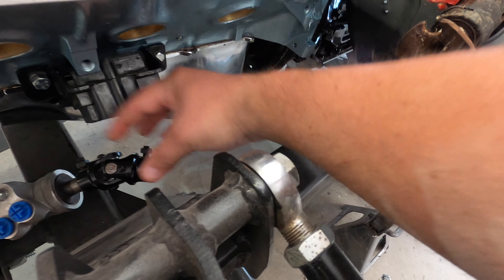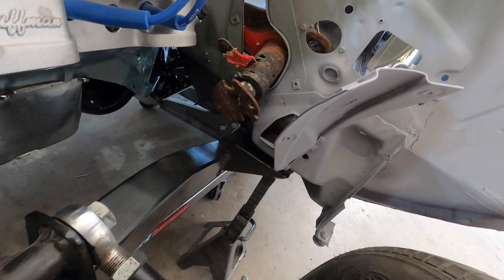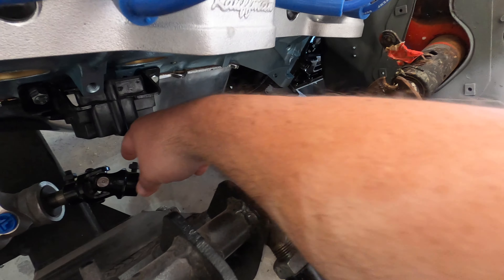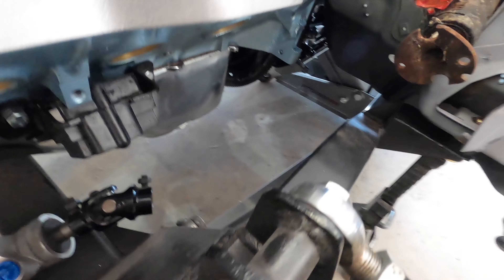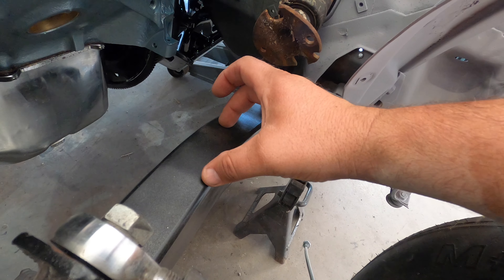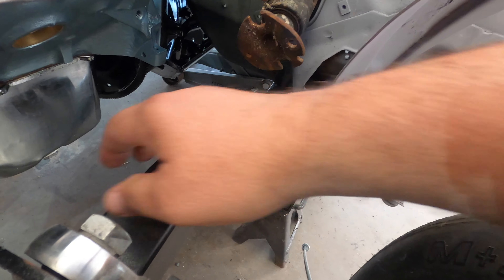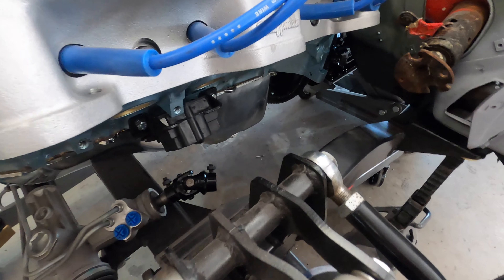Once you put these headers in here, they come right through and go right underneath. You have your steering over here — I just have this stuck in there for a reference point — and then you have this knuckle here. With those headers it runs right where you need to put the steering. I had a feeling I'd have to notch this frame out somehow to bring it out, and when it's notched it would be boxed back in to make it strong again. That was going to be the hardest part.